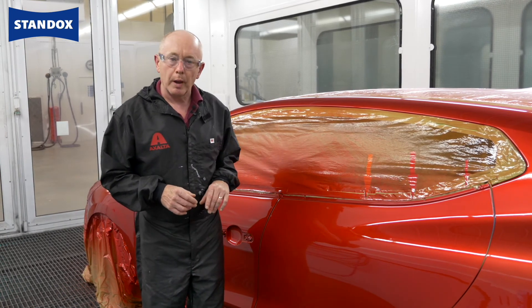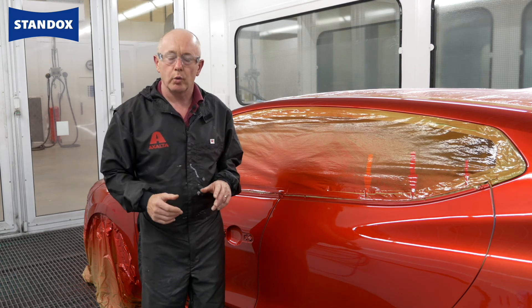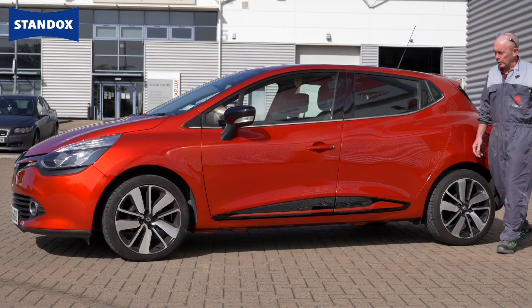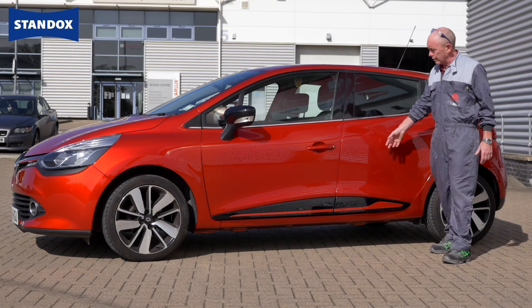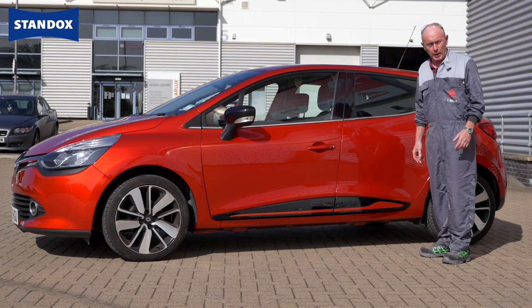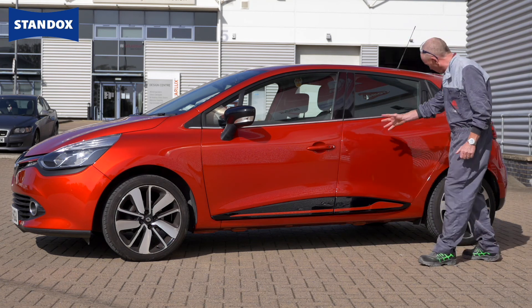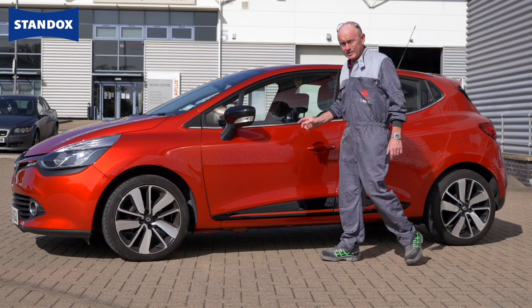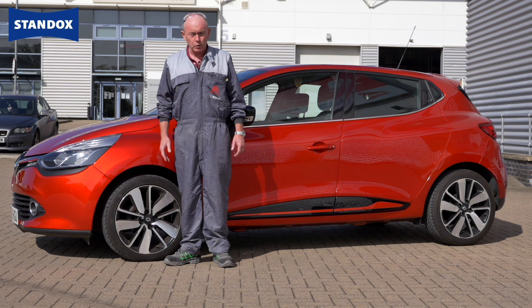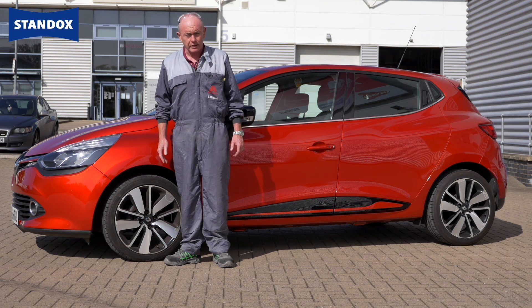It's time to remove the paper and put it outside as always and check it in sunlight. I couldn't have picked a better day to show you the end result — just the depth and intensity of this colour now that we've finished the repair. Remember, we've shown you both a blending technique here and we've also gone edge to edge here on the bumper. Thank you very much for watching. I hope you've enjoyed it. I'll see you again soon.